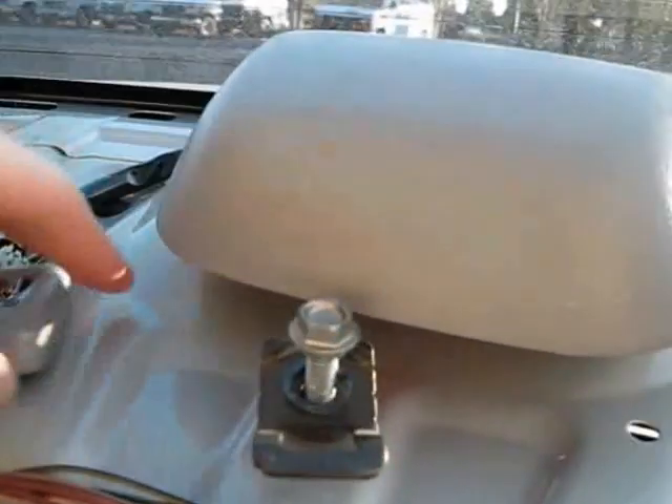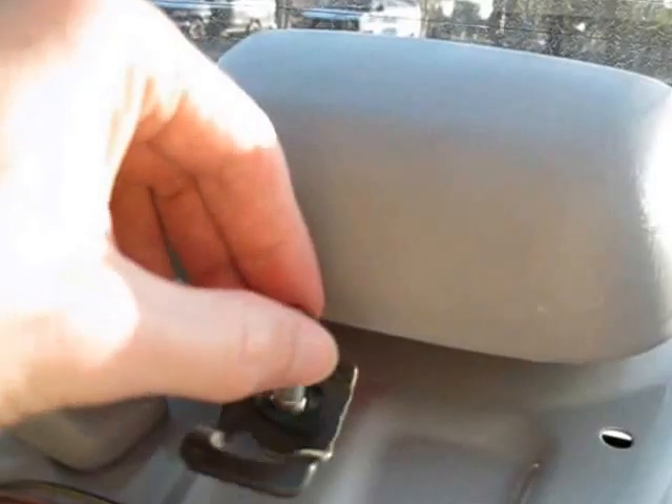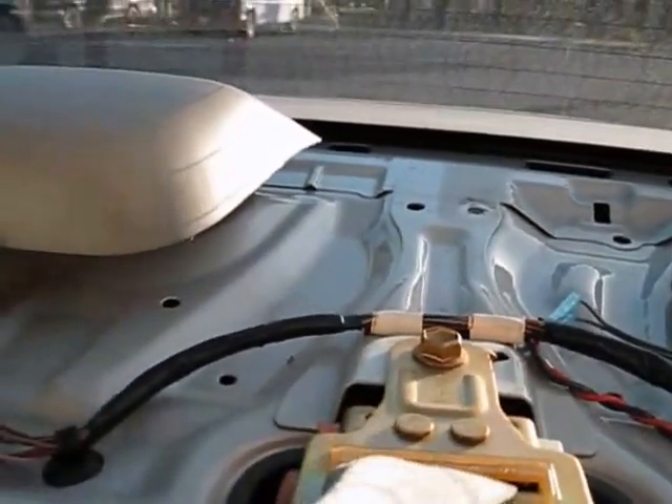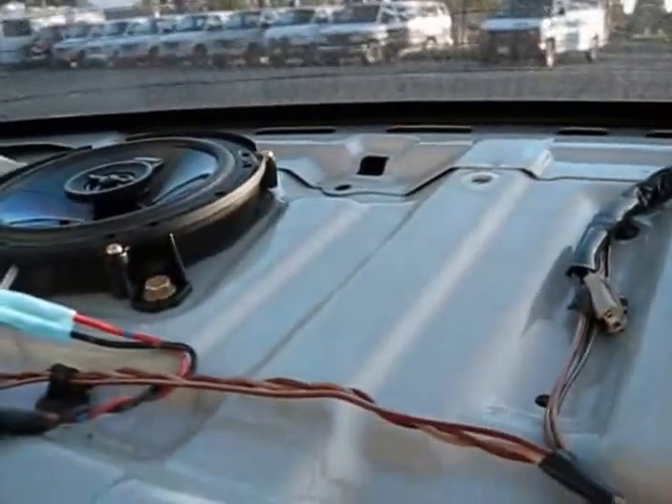What you need the socket wrench for is these bolts. As seen in the other video, you pop this plastic there and then socket wrench that out. There's three — one there, one back there, one back there. And you're gonna have to take your seat belts — you just have to work them through the little slot in the back speaker panel.